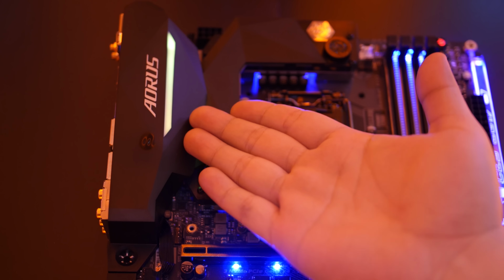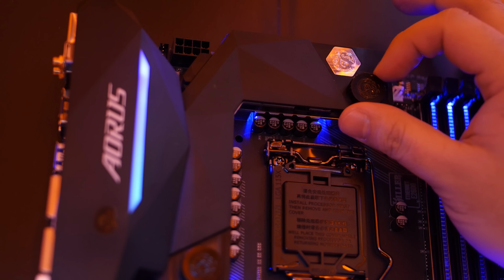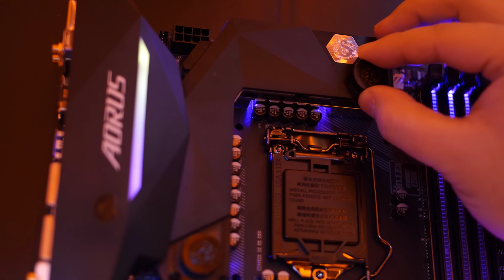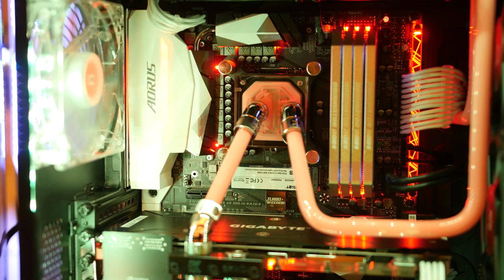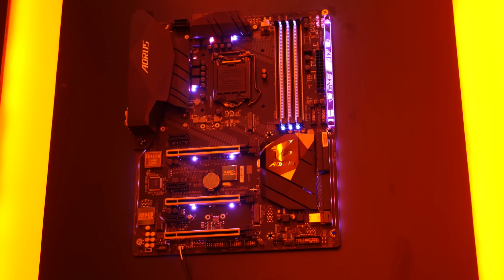So for the water cooling for this generation, we're working with two manufacturers. We're working with EK Water Blocks. They're very big in Europe. We're also working with Bits Power, who are big in Asia, and they have the water cooling block integrated directly on top of our VRMs. We've also made sure that all of our other Aorus motherboards can support a monoblock, so you can go out and purchase one and directly mount it onto the board and not have to worry about configurations. Definitely check out our water cooling site if you're looking for that kind of information so you can see which parts are compatible.